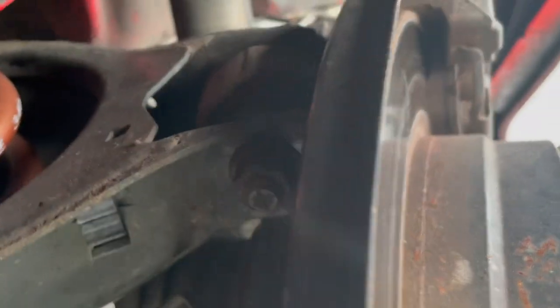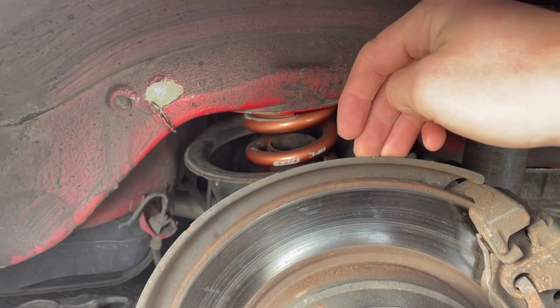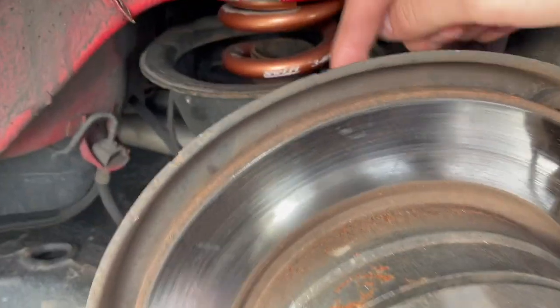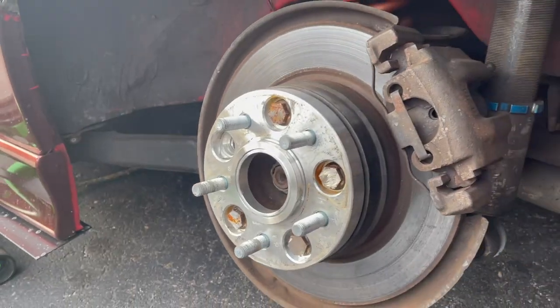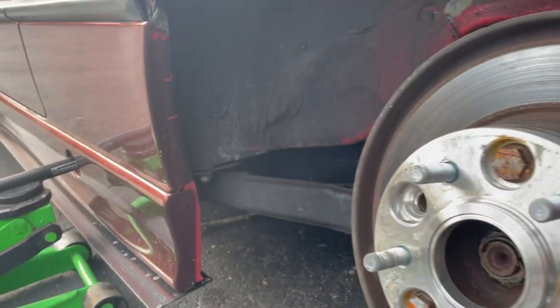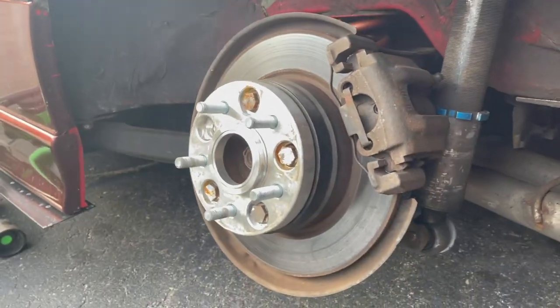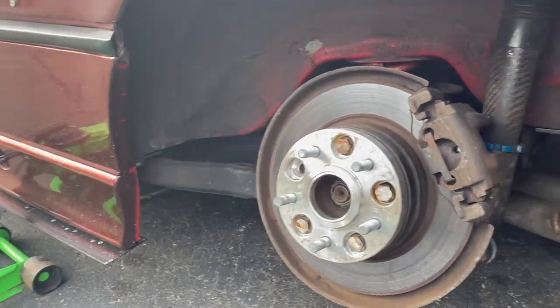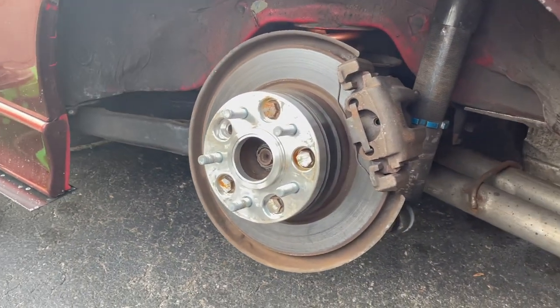I've done this on both E36 and E46. The only difference is with the E46 having the cast arms, you don't have to slot the front ear. On the E36 I ran into issues with the ear hitting the back of the brake shield, so I had to cut it a little bit up here. But on E46s you don't have to do that. With about 11 degrees of camber, you don't have to modify the trailing arm bracket in order to get zero toe — this car is currently at zero toe completely. But if you start running more camber like my E46 did, you have to do trailing arm brackets, which I'll show you in a second.